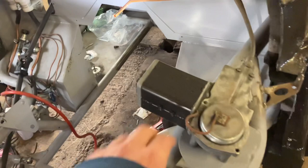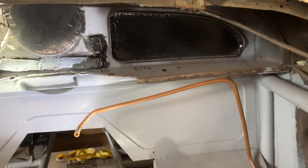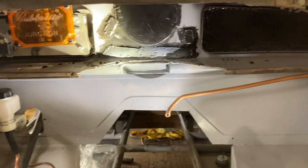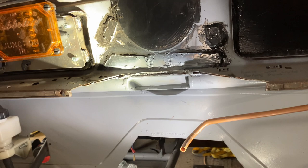We're running the standard Morris Minor wiper system. I did look at putting a two-speed in, but both speeds I've used before — I always found the second speed way too fast and the first speed is fast enough, so that'll do. I've had to blank off all the Morris Minor panels due to the fact that this is a firewall now, so the engine sits dead in here. We've had a little notch on this beam here because the dizzy sits so close — we cut out a new piece, turned it round, put it back in, filled both sides, just to gain a little bit more room for the dizzy because it's so close to touching. You can guarantee when adjusting it, it'll be right in the wrong position.